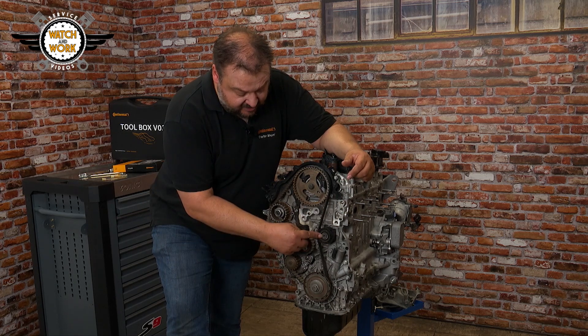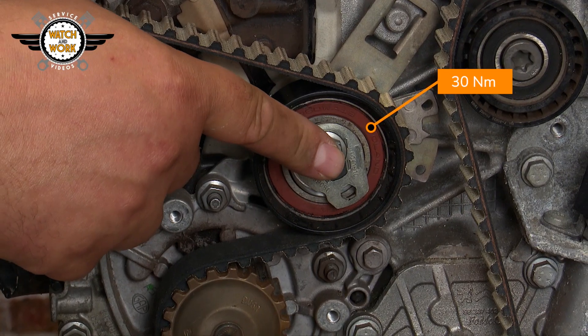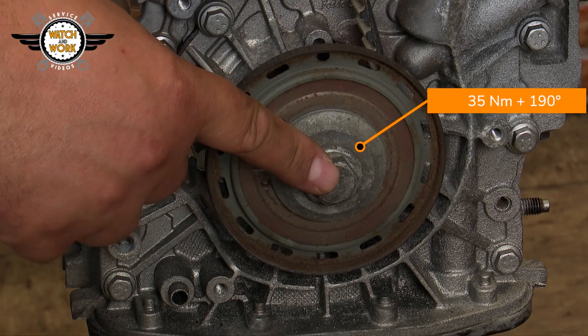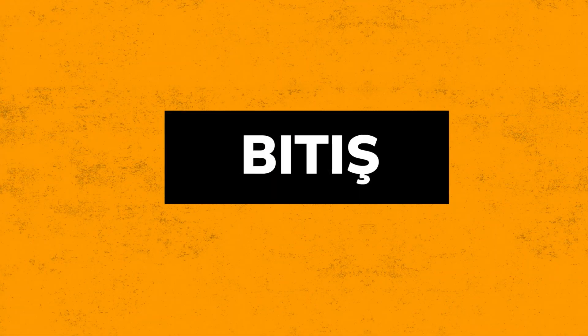Tighten the deflection pulley to 35 Nm, the tensioner pulley's nut to 30 Nm, and the crankshaft belt pulley's bolt to 35 Nm plus 190 degrees. Don't forget our seal of quality — place our part replacement sticker in the engine compartment where it's clearly visible, so that the customer sees you have fitted quality.